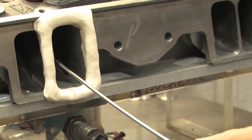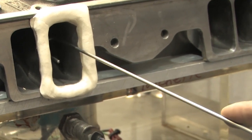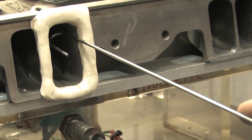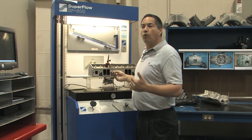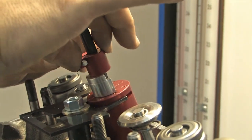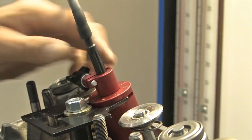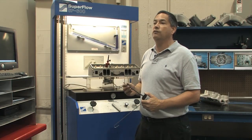The problem with that is sticking the pitot probe in the port is like sticking your finger in the port — it affects the flow. It affects the dynamic and the static flow that's in the cylinder head. The closer you get to the valve seat area, the more it affects the flow. What we've done here is we've worked on a new invention: the pressure differential valve, because everything about CFM and understanding flow differentials is in pressure differentials.